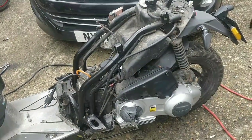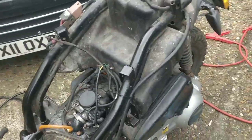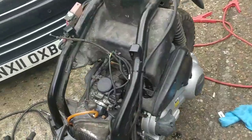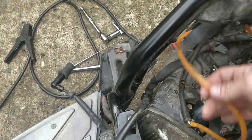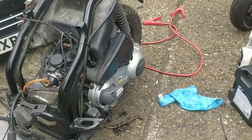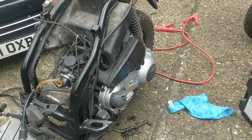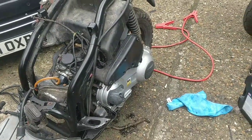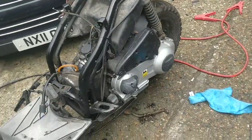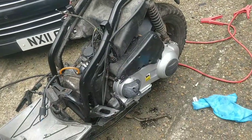The engine seems okay. Step two, obviously, probably cleaning the carb properly now, making sure all the fuel lines and suction lines are good and small, but they don't need to be that long. I might try the Chinese carb on it next week. If it runs better with that automatically, then we're automatically better off immediately. So that will tell me basically if I need a new carb for this. And then it's everything around it.